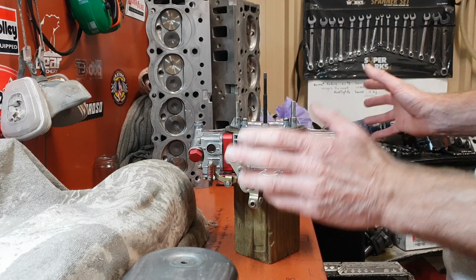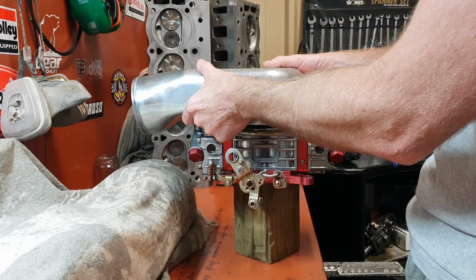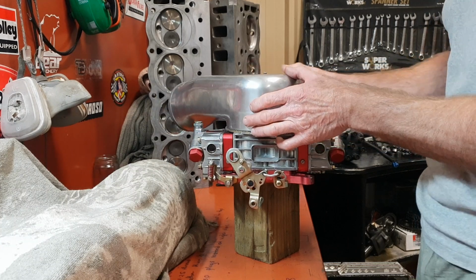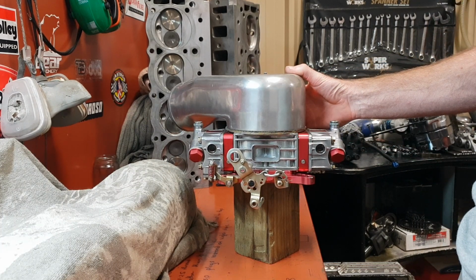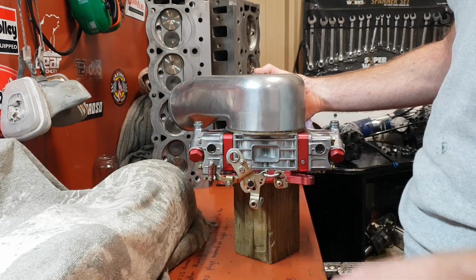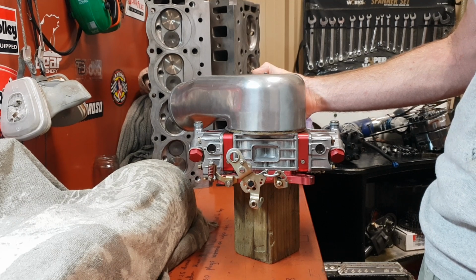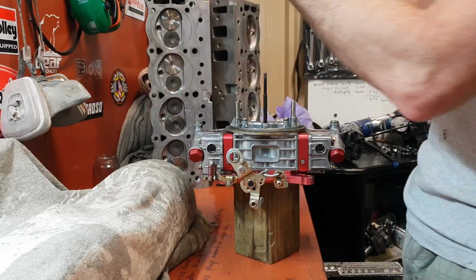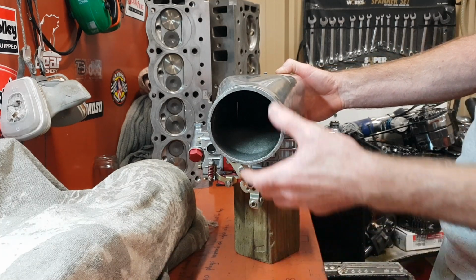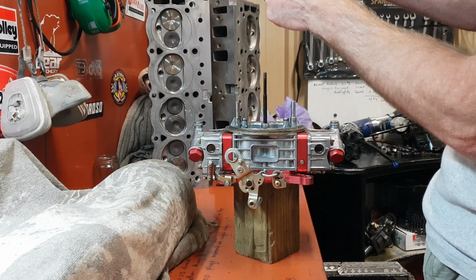They're never going to be perfect, but at least we can improve on what we've got now. And looking at that, that is a shocker, guys. I mean, I've run like that for years. Everywhere I clock this thing seems to cause problems. I had it like that when I first got it running, because I had the intercooler in the front and it was all coming up on that angle there. And number 1 cylinder always gave trouble. If I ran lean or over boosted or got hot for some reason, I'd push a gasket on number 1. I move it round here, all of a sudden I've got number 4 really giving me a hard time, and it's looking like it's not liking this short turn.